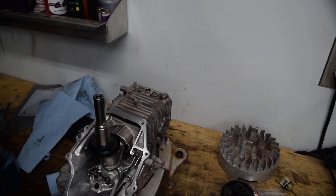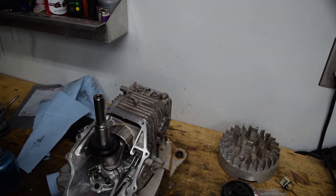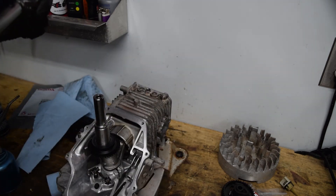As it turns out, all of the bolts that need a torque spec — which include the connecting rod, the case, and the valve cover — are all the same torque spec: 108 inch-pounds, or 9 foot-pounds, depending on what your torque wrench uses.